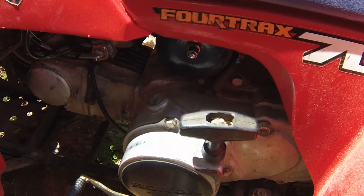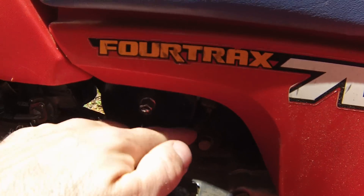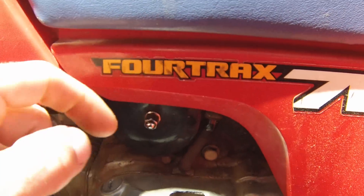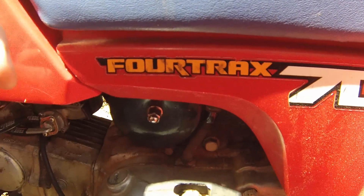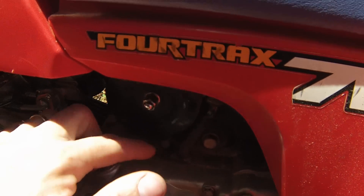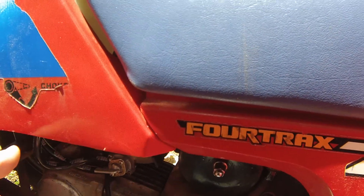About 50 times or so — that'll help wear it in a little bit and you're good to go. If that still doesn't work, try grounding it out like I said. Just unplug the wire that comes from this harness here and ground it on the wiring harness side — not on the side that goes to the crankcase. Put an end on it and ground it; you can put it right to this bolt here or that bolt there, whatever you want to do.